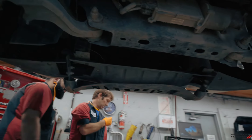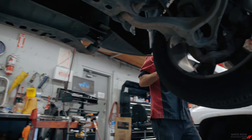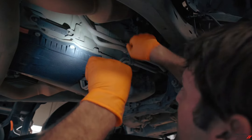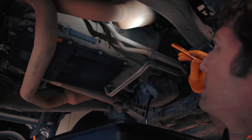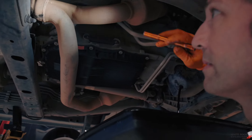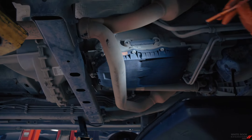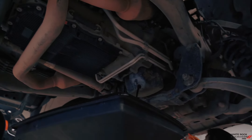The other thing we do when we're down here is we take a look to make sure there's no exhaust leaks, any oil leaks, any coolant leaks. Check the shield — that's your tranny pan. We look around there and make sure we don't see any leaks. Looks like we got a clamp here that might be leaking a little bit — yeah, that's your coolant leak.